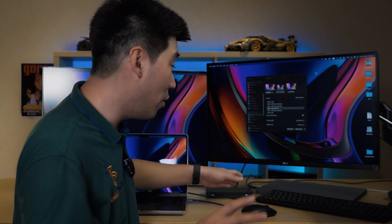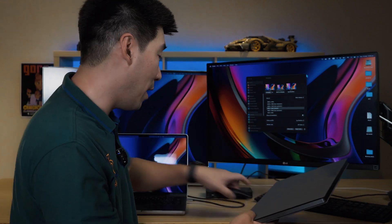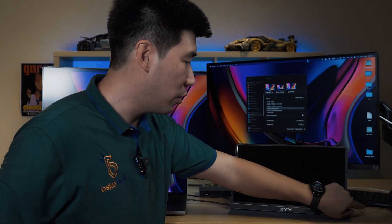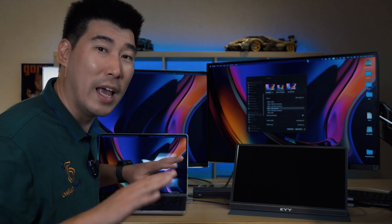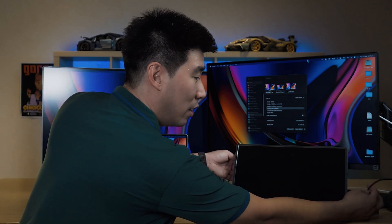I'm going to test the front USB-C port to see if it can drive a third monitor using a USB-C portable display. As I mentioned, I tested this and will show it live. I'm connecting a portable monitor, but this USB-C port is actually for power only. The USB-C port and the two USB Type-A ports do pass through a little power but not enough for fast charging. This portable monitor requires 15 watts, which the docking station cannot provide through that port.